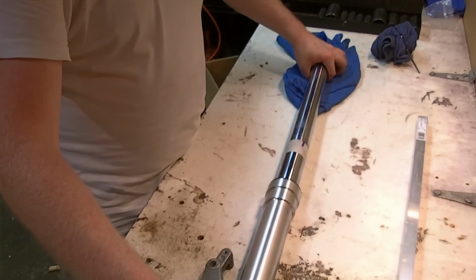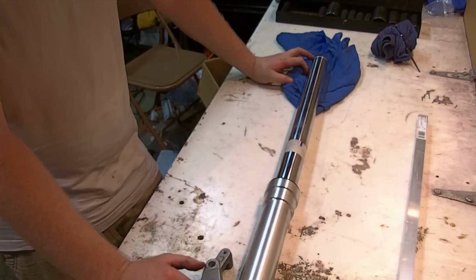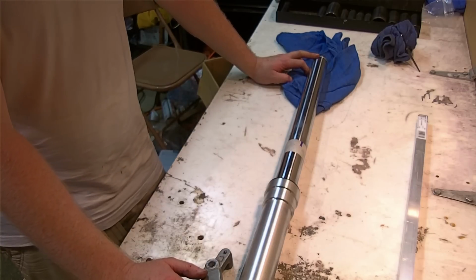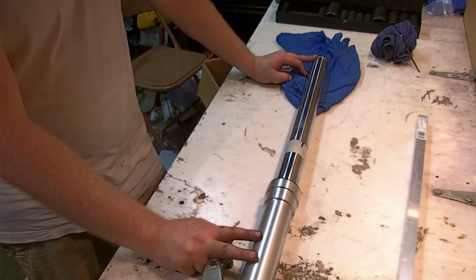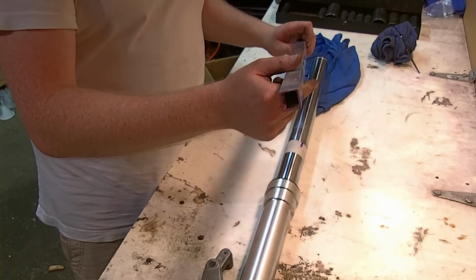The service manual has you use one of those special tools. As we all have been told, 3/4 inch square tubing, aluminum is what we seem to always get, because you can easily get that at a Home Depot or hardware store. It can be had because the top of the damper rod, which is inside the lower leg, has a square shape up to it. And that square happens to be the same as 3/4 inch outside diameter tubing.